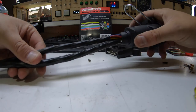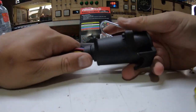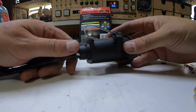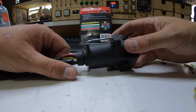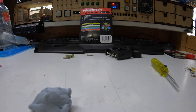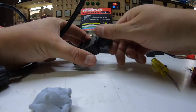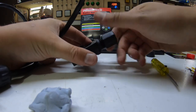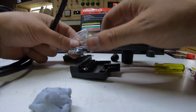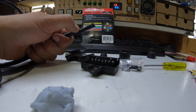Everything is in. When doing something a connector isn't really designed to do, you end up with a bit of damage here, but it does the job. Crucially the multimeter says nothing came out - so we're happy. I guess we're going to go crawl under the ambulance and see if we've got trailer lights now. But wait - there's more - I forgot the seven pin flat! Next job is to wire the seven pin flat in. Same grommet setup here and the strain relief has some assembly required - we'll get this on and then try crawling under the ambulance.